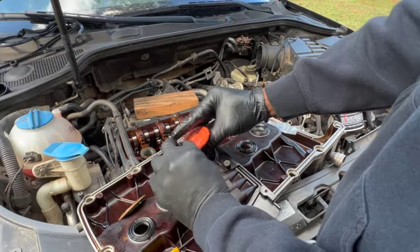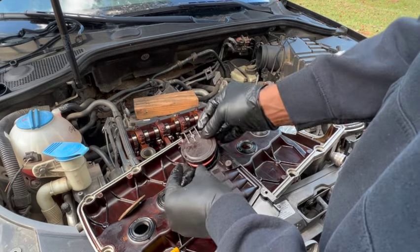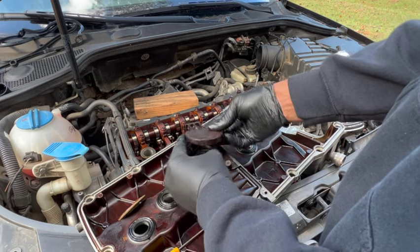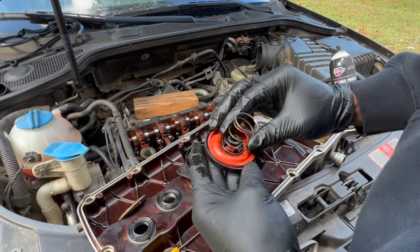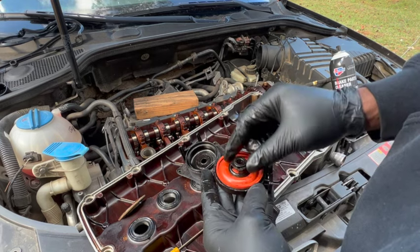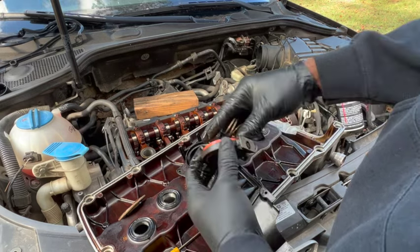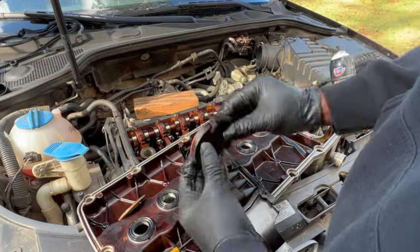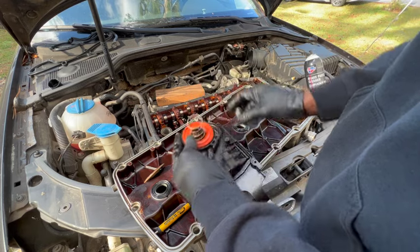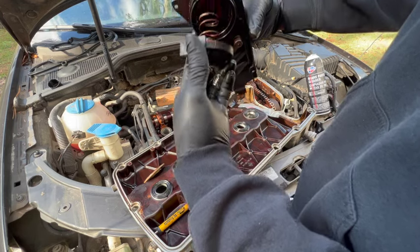At first, when assembling this valve part together, it is not gonna sit properly because of how it's locked into each other. I was having issues and was a little bit confused until I figured it out. You just gotta make sure that the spring right here sits properly on top of the valve and that it sits properly inside the cap. Once that is correct, you should be okay. Put the spring inside just like this and then push it down. At first it was a little bit finicky, but I hold it upside down like this and that's how I was able to lock it up.